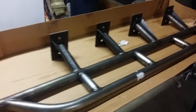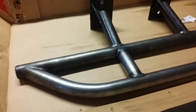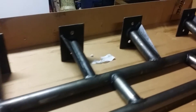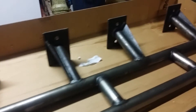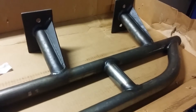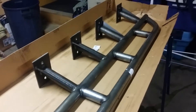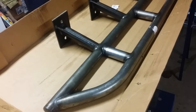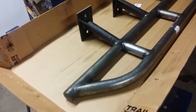Here they are, exposed out of the box — they come in raw and oiled to help prevent rust. These are pretty beefy: one and three-quarter inch tubing at point one twenty of an inch, drawn over mandrel or DOM steel. From what I'm hearing, it's very strong — this is what they make roll cages out of, as opposed to other types of steel used for rock sliders. These are the heavy-duty version, so it'll be more than sufficient for my use.